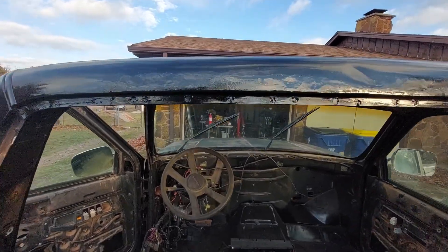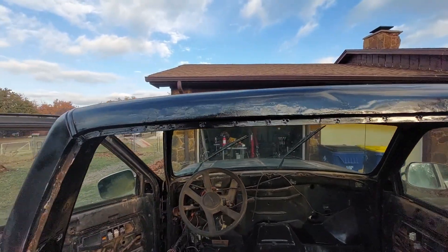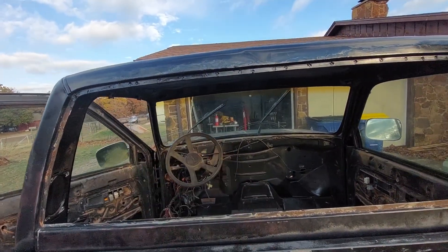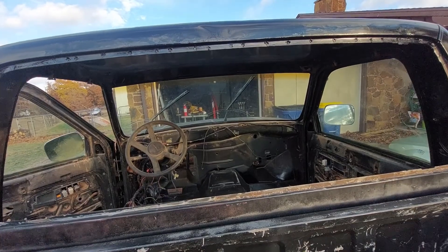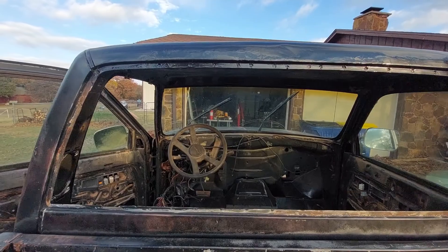It's painted now, and it is ugly. This is Rustoleum right now, and I've got to put the window back in. Talking to some other people, the urethane they use to stick the window in doesn't stick well to Rustoleum, so there's a good chance if I leave this Rustoleum the window will pop out.